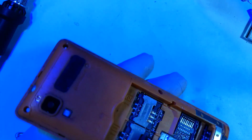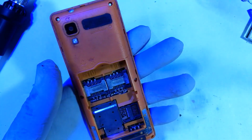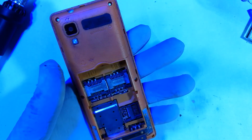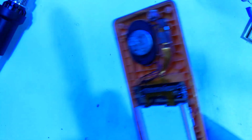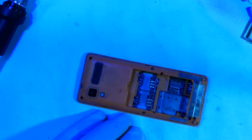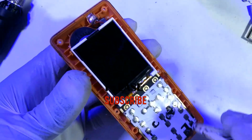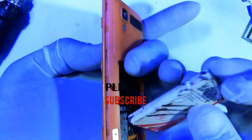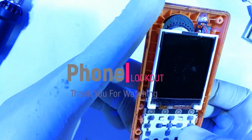Okay, lucky for me, I had removed the battery, so I think it's almost second nature that I find myself detaching the battery from the phone before I do anything else. But then again, now I've hidden the battery, I need to test the screen I've transplanted. Let me pause, find the battery. Okay, now found our battery. Place it in right there and power on the phone.